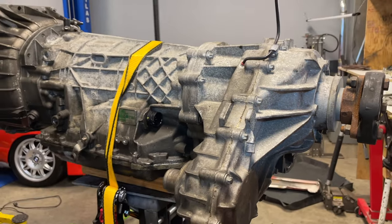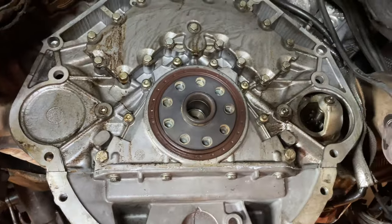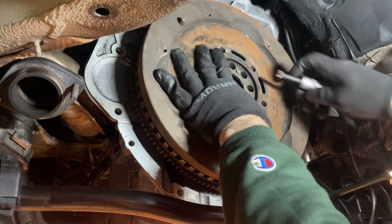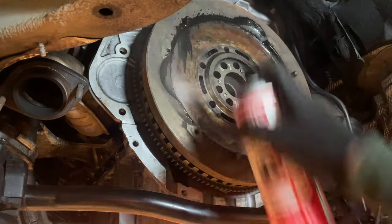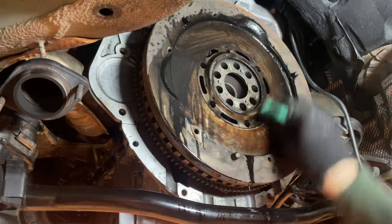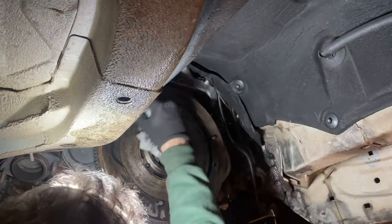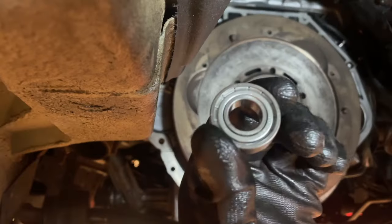There's the hunk of metal, and we're replacing it with a much lighter, more fun version. We're installing our dual mass flywheel — the bolts are already in there so we torque them down. I cleaned the mating surface on the flywheel, though you really don't need to do this. You probably should get a brand new flywheel, but this one was in excellent condition, so there was no need, especially for the purposes my customer is using it for.